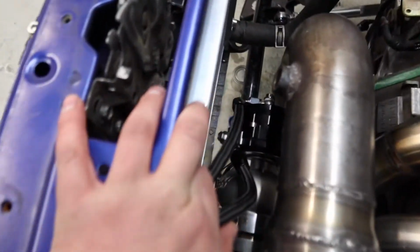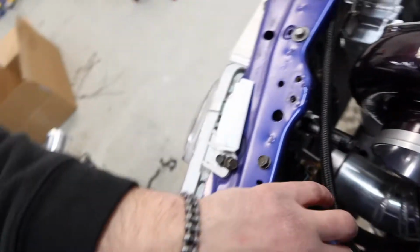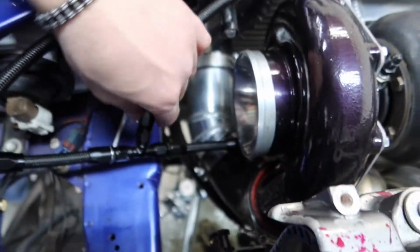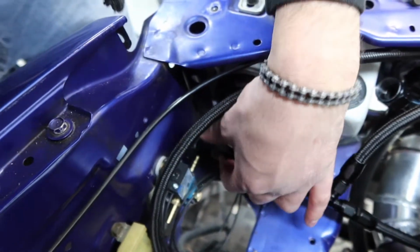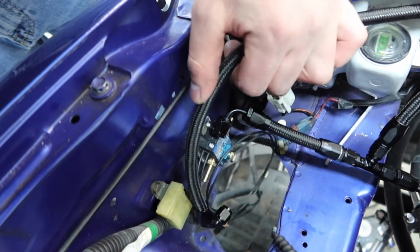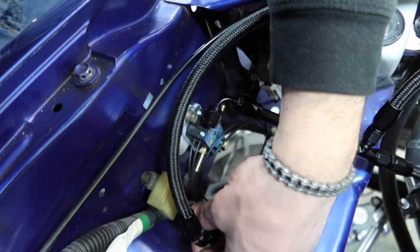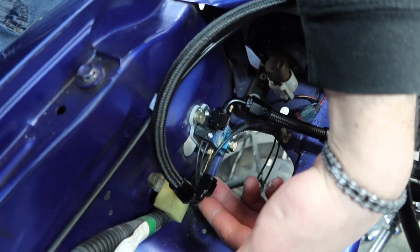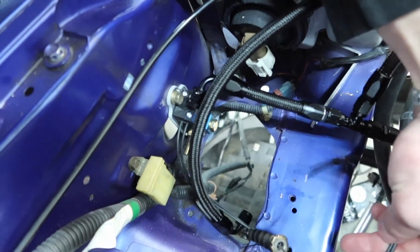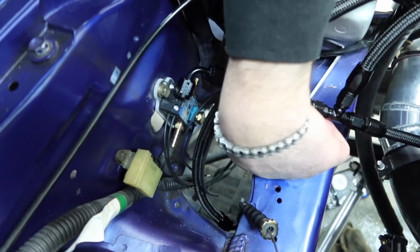The vacuum lines for the wastegate, I have both of them there, and I'm gonna tuck them up nice under here. But those, I made the T from the turbo to the wastegate to one side of the boost controller, which I have the wrong fittings, I have to get them, but I made the lines anyway because I know that once I get the fittings that I have all the right stuff. So once I do that, then those lines will be done, and all I gotta do is wire this into my ECU. So long story short, all the fuel lines are completely done.